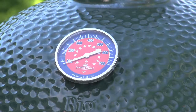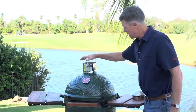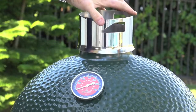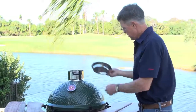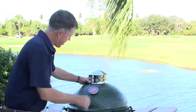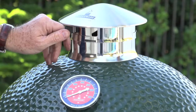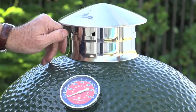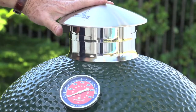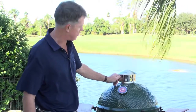Lastly, we'll install a new top. Installing the cap is obviously easy. The felt's already on the chimney. You just press it down until it's all the way at the base, and then drop your cap on. I like to set it up so that the graduated opening starts right above the temp gauge, and then you can open and close it. The vent is actually away from your hand, so you don't get hot air exhaust on your hand when you're adjusting the temp settings.